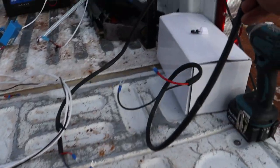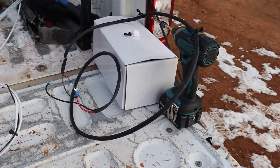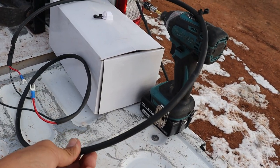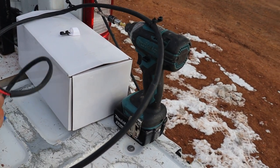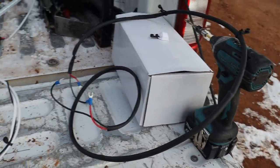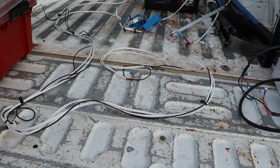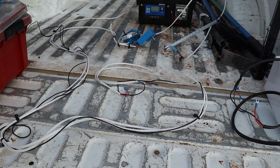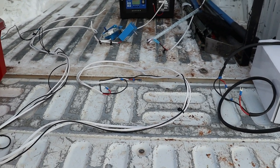This is our custom water heater wiring harness, which is really nice. It's a 12 strand wire with a shrink tube on there. So if there was something going on and this wire was getting hot somewhere, you would see it start to shrink and you'll know it's getting hot right there. Secondly is the wiring harness for everything from the pump to the switch to the lights, and then to the battery.